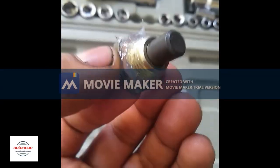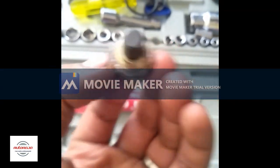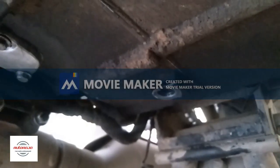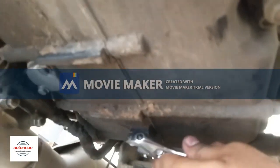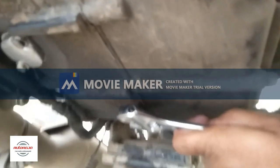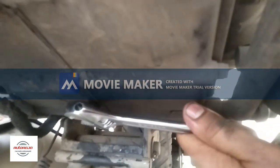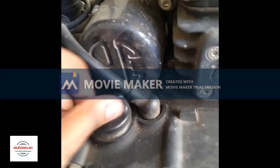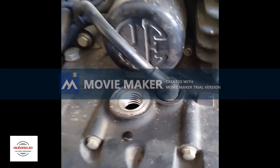And this is the drain nut that you get, and this as well you are covering the edges with anabond solution. Once we have put anabond solution across, we are just putting it back in place using a 20 mm spanner. Make sure that you don't hit your hand around the engine corners. Be safe. And to replace the oil, I'm just removing the oil lid.